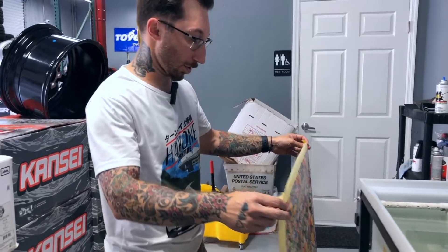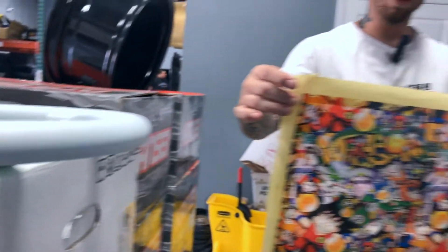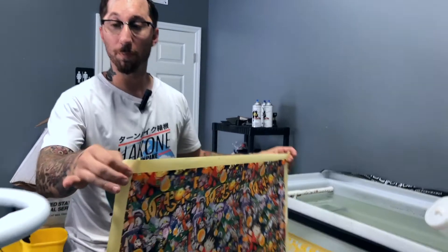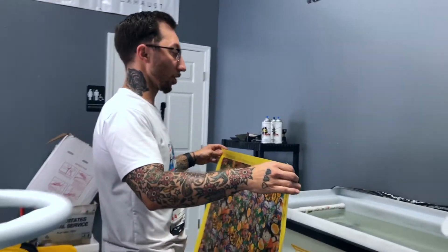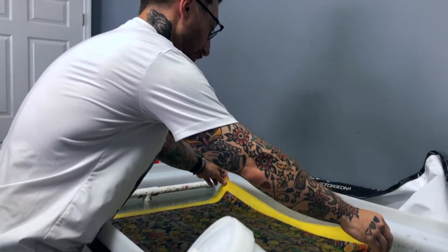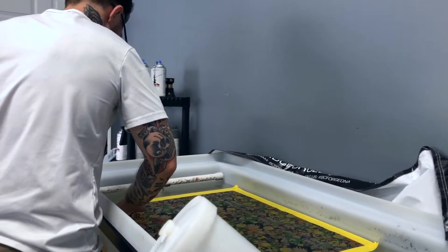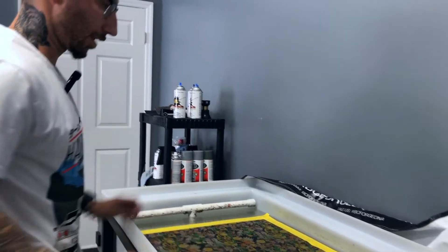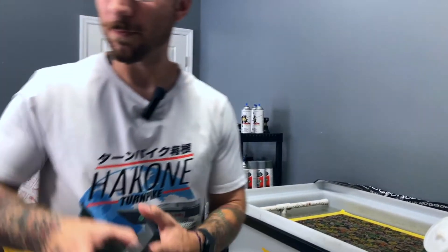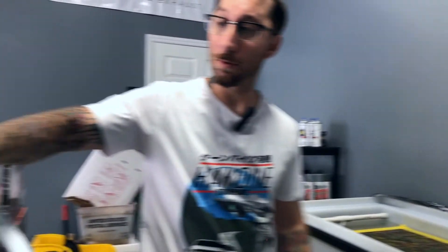So the second part of this process — after you get everything coated — as you can see, we've got our wheel nice and coated with the base coat that we wanted to do. Some of your graphics are going to have see-through spots. Those see-throughs will pick up the base coat from the object that you're going to be dipping. So we want to make sure to get our paper in there nice and clean, make sure your water is up to temp, and we're going to let that sit for a nice minute because we want that paper to get hydrated — you want everything nice and warmed up — so that way when we spray our activator on, that's going to help that paper adhere to our wonderful steering wheel.